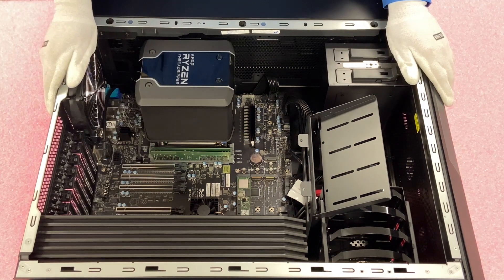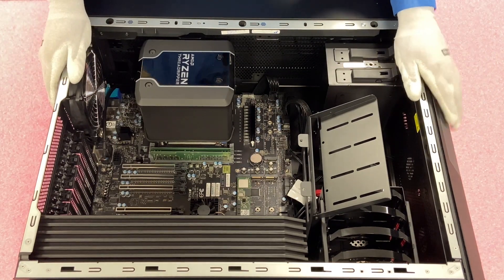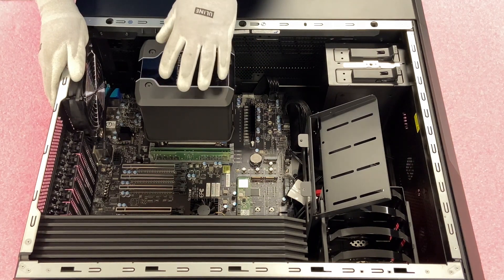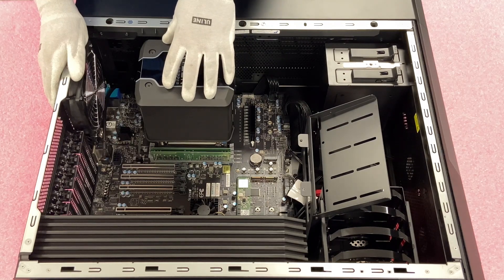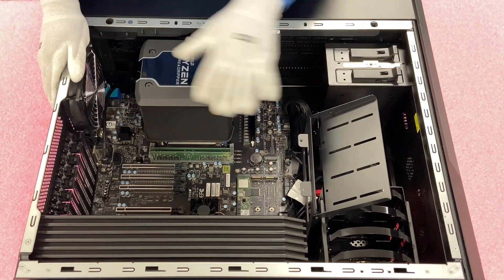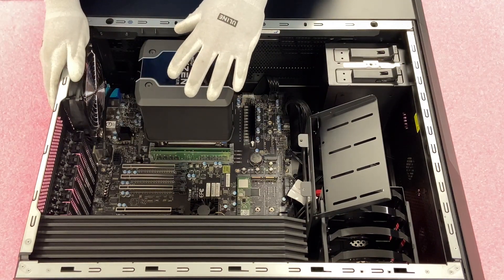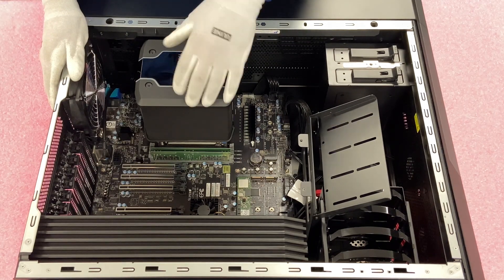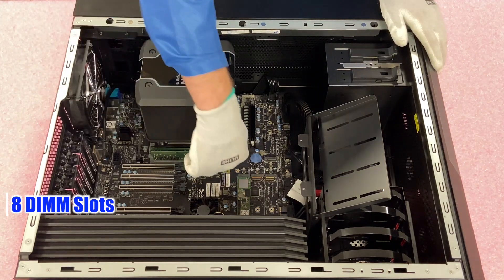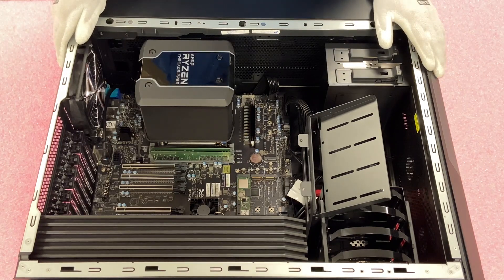So while we're going over our specs, I wanted to pop on my ESD gear, open her up, and show you the insides, because that's the fun part anyway. Here is this massive heat sink — these things run so hot that you really need as much as possible. This whole thing is really designed well. I took off the air baffles already that covered this whole section. It's almost like a second top on it, and you have your heat sink and CPU in here. Under here are going to be your eight DIMM slots — four here and four here. Right now we've only got four modules in there.